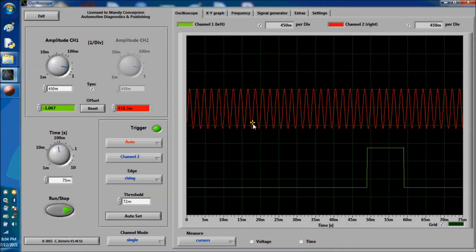What you do is you go two cam revolutions, okay, and then you count the number of pulses on the crank, okay, and that also tells you. But then you have to have a good known waveform. Once you get used to doing this stuff, you're going to know more or less.